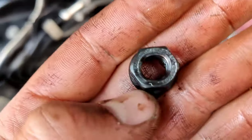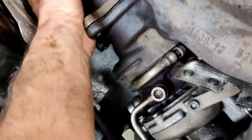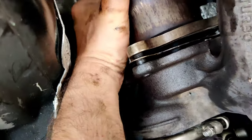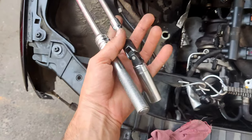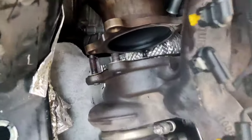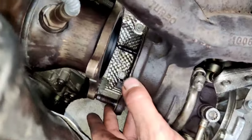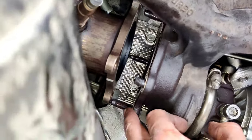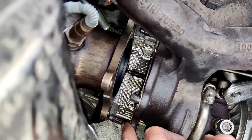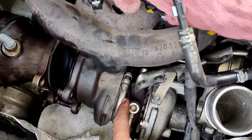This is the last nut from the catalytic converter. As you can see, there is also a gasket here. This is what I used to remove the last nut from the catalytic converter. When I started removing the catalytic converter from the exhaust manifold, it has four studs and four nuts. When I started to remove the first nut, I broke it. So on the rest three of them, I used some WD-40 and left them for about one hour, and after that I removed them very easily. Don't repeat my mistakes if you want to save the nuts.